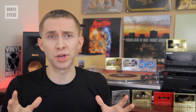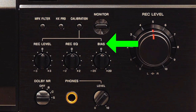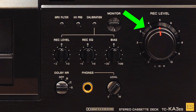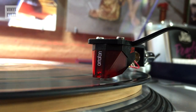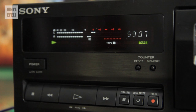Now a couple of things before we get started. All cassette decks are going to have some sort of bias adjustment — bias is basically a tool that helps you improve the sound quality of your cassette recordings. Some decks have automatic bias, which is convenient, but I actually prefer setting the bias myself. All you have to do is make sure your volume is set to a good level, then press play and record on the cassette deck, and after several seconds of silence, press start on your turntable and drop the needle on the track you want. Once the track starts playing, adjust the bias to the position that sounds the best to your ears. I also like to set my volume level to where the peaks are hitting zero — a nice loud volume, but not so loud that it's getting distortion.